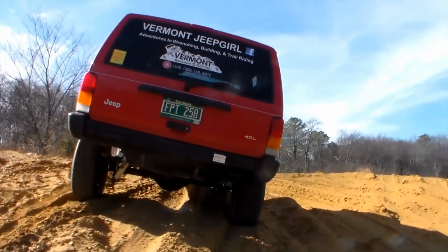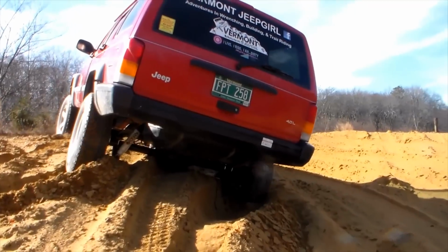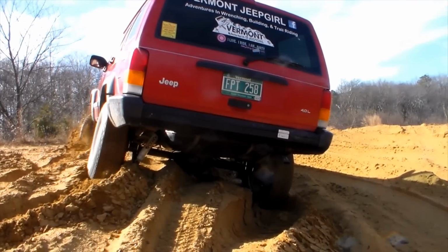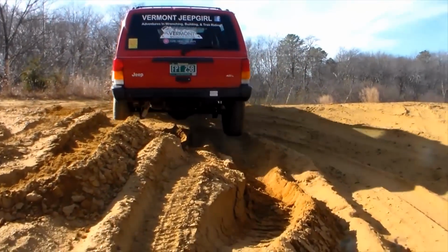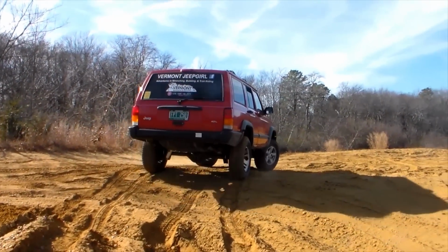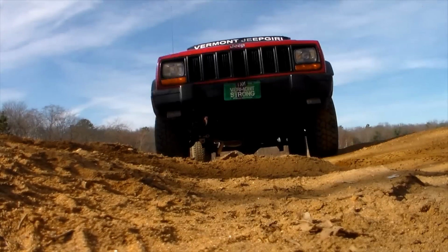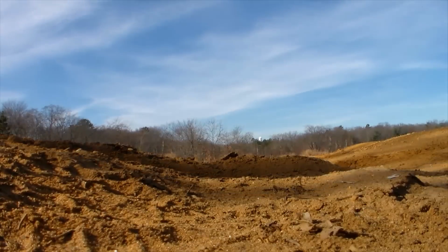The Aussie Locker is safe off-road and on. Unlike manual lockers, which do not provide differential action when locked and severely hamper steering and directional maneuverability, the Aussie Locker's smooth and sensitive operation allows differential action, resulting in uncompromised steering, uphill or down, soft or hard surfaces. Even on highway driving, the Aussie Locker does not impede performance.